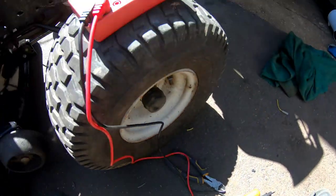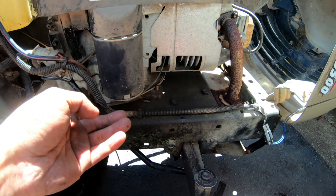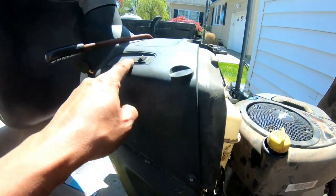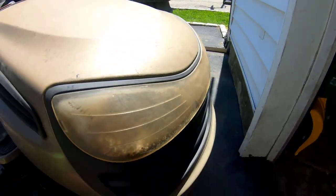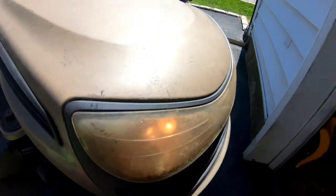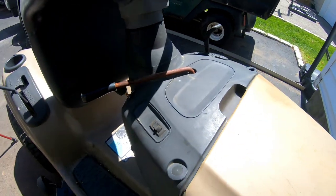All right. Some multimetering, some figuring out where the current is, not finding the current in the main one, trying to figure out why. Enough of that. I tapped into the fuel solenoid power source, connected a wire to the switch, and bing! There you go. Got headlights when you need it. Gonna have to clean the interior of those lenses for sure when I decide to power wash this thing. So it's got a separate switch for the lights when the power is on.